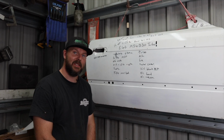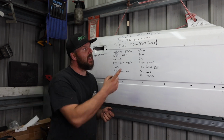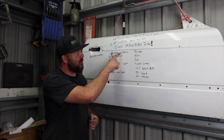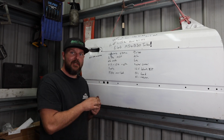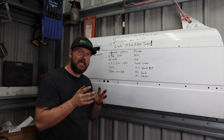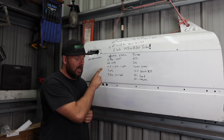I've had a lot of people ask me the specification of the engine. So it's E46 M54B30, so it's a 3 litre, and we have added turbo. What do you need to do to add turbo? So you need more fuel. We've gone for 630cc Bosch injectors. Mass airflow sensor can't keep up with boosted amounts, so we've gone for an RS4 MAF that's been mapped into it to accommodate that, but that's good. DG Maps have done the mapping and will be doing the mapping.